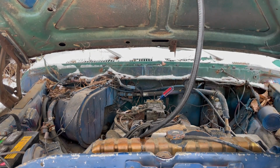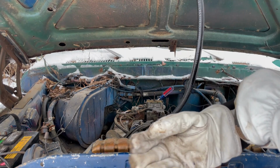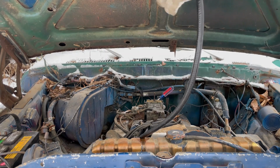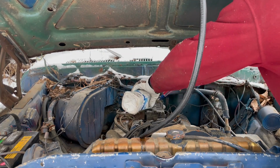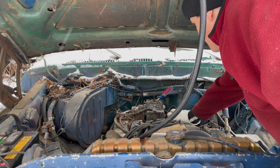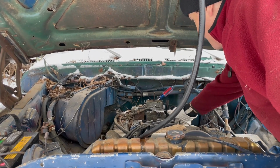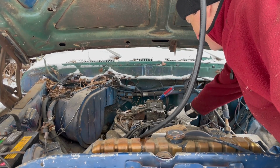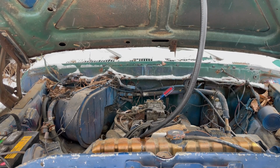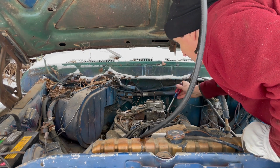So it explains also the reason it kicked over and fired. It explains what that spark was. The key must be on, even though it doesn't indicate it's on, it must be on. And that's what the spark is, because I never hooked up the ignition. I just got spark from it anyway. I'm going to fire this up again. Okay. Idle this thing up a little bit.